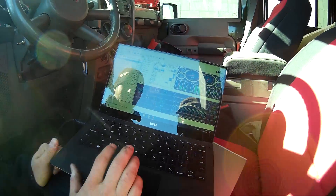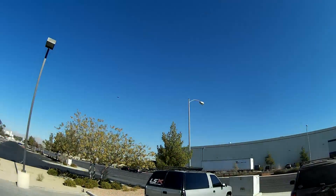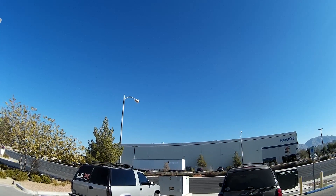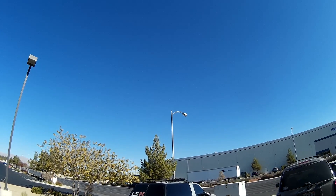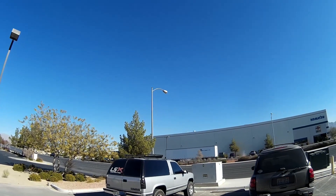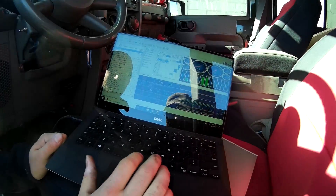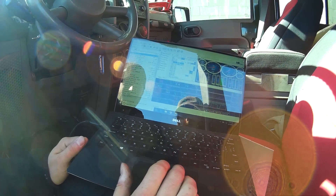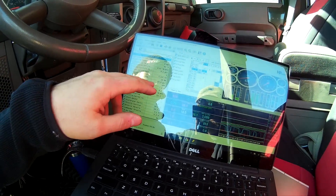What Mitch is going to show you here is AC pressure versus fan speed. This fan is being controlled by vehicle speed, engine coolant temperature, transmission temperature, condenser pressure, and other factors. So Mitch is going to show you the relationship of condenser pressure and fan speed. Right now the AC system is not turned on — it's not activated, but it's at 67 psi.